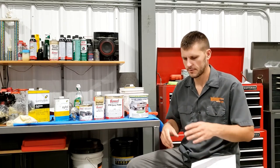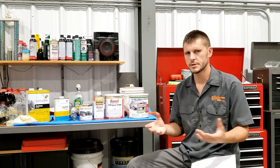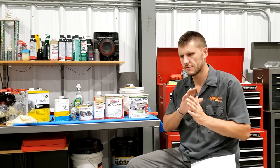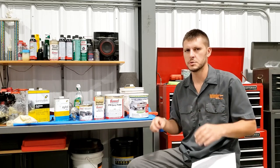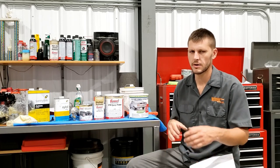So I ruled out powder coating. Powder coating is great if you have one part that you can access all sides of. But once it comes to a frame, unless you're gonna split that frame down 100% into each individual component, it's not worth doing it because you're gonna have rust coming out of all those seams and it's gonna look disgusting, and you're not gonna get the protection that you're trying to get by powder coating it. So it'd be a huge waste of $500.